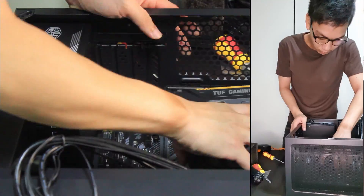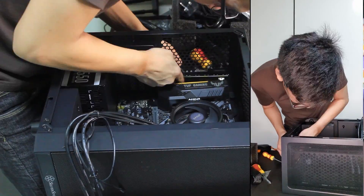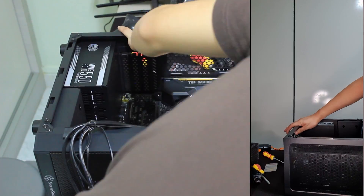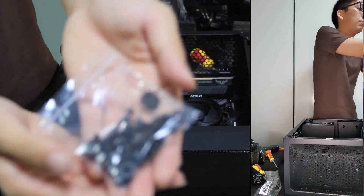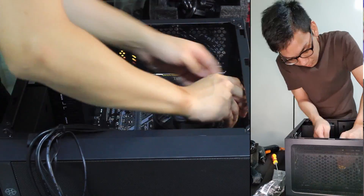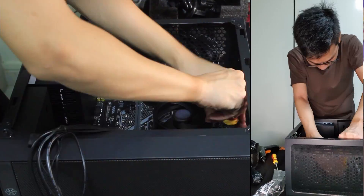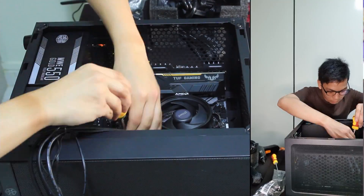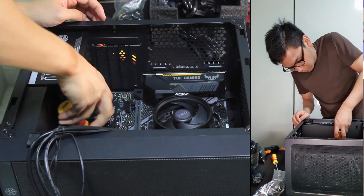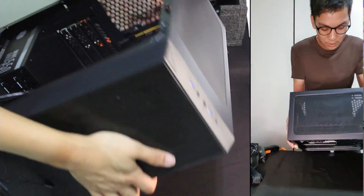Okay, now I'm removing the fans just so that there is better clearance, so that I don't need to squeeze my fingers around. After that, double check everything is fine. Then you want to install the motherboard screws — make sure that the standoffs are in place, then you can screw them in. This is not the same as your CPU cooler installation, so you don't really need to do this in a criss-cross pattern — clockwise, anti-clockwise, or however you like. Just make sure that you don't over-tighten the screws. That's actually very important.